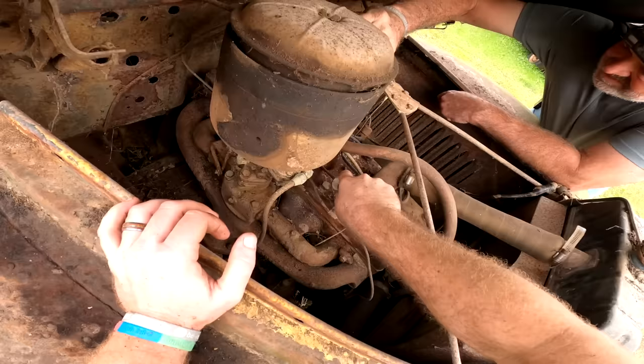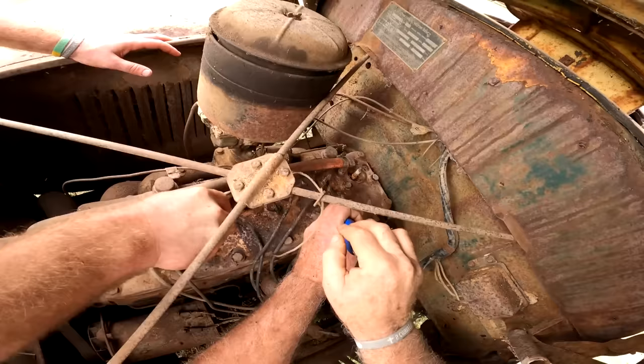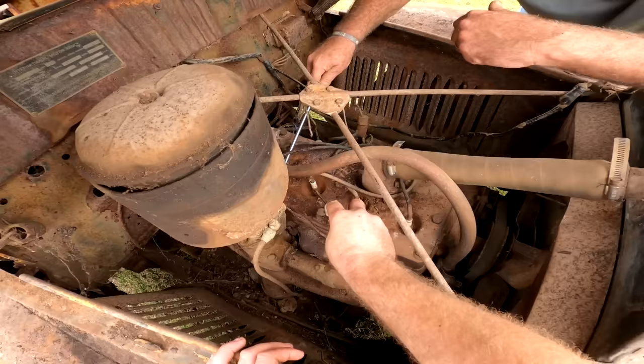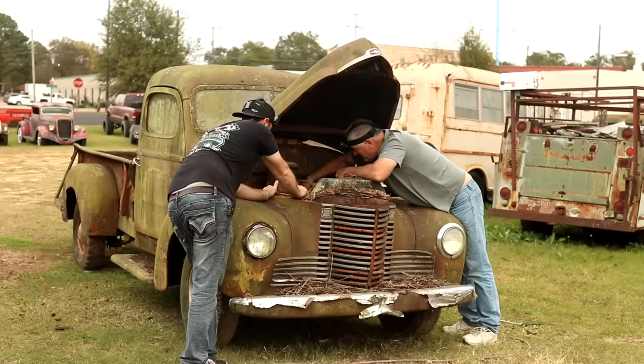Man, I don't know. Might be able to chip enough off right there, that little spot. Get that one to have something. No, I think I just took off the little bit of it. There's nothing there left to grab. I'm down to the porcelain right there, all the way down, where it goes into the head. I bet the only thing you can do is just break them and then drill them out. Yeah, take an easy-out.